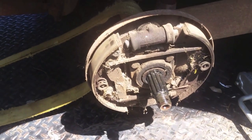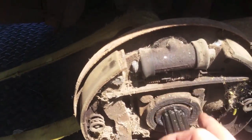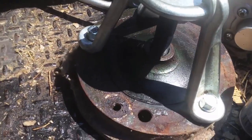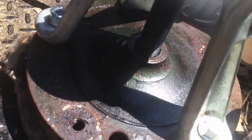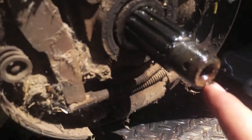There you have it — no more stuck drum. Occasionally it'll pull the shoes. I've actually broke a wheel cylinder with this before — it's a pretty hefty thing. Just make sure you've got the spline centered in the tip of your axle where that little divot is. This side's a little harder — let's see what breaks when this one comes off.